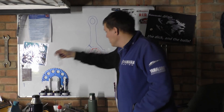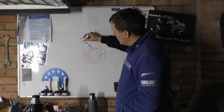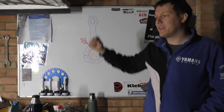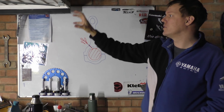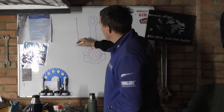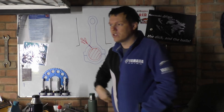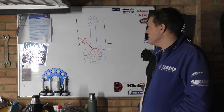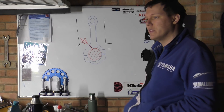Some of this oil comes out here, comes out this hole and squirts up. As your conrod is moving around in your engine — going down and up, down and up — this basically squirts the inside of your cylinder. This is how we lubricate the cylinder wall the old school way, which the rings then take care of later on. It also helps with cooling, because it goes onto the cylinder walls, takes heat with it, and drips back down.